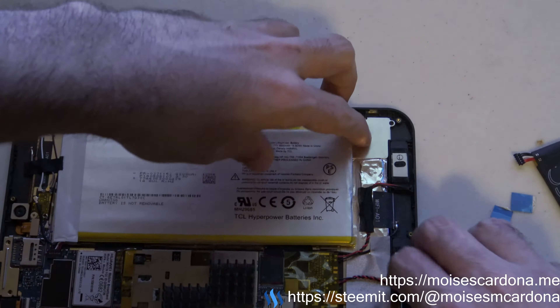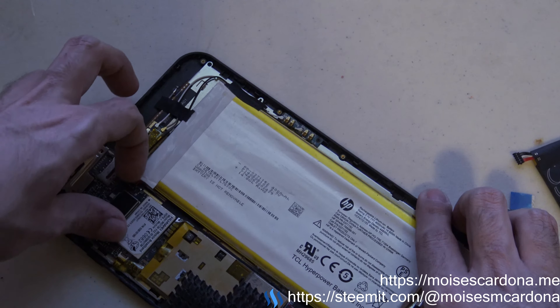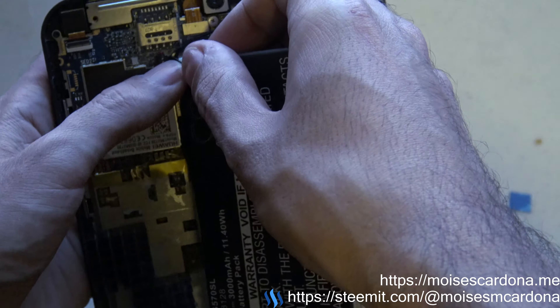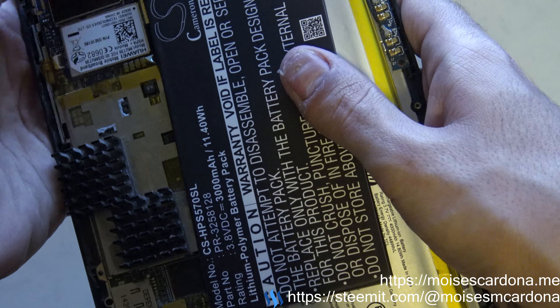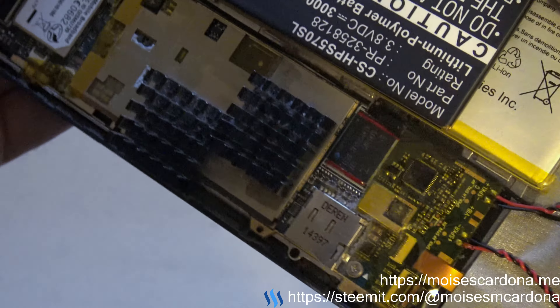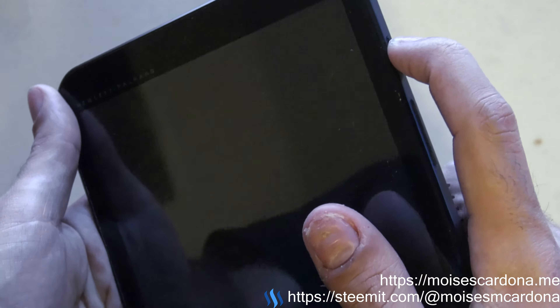Be very careful indeed, because the battery can be bad. Let's do this pretty quick — just detach the cable from here, and now attach the battery cable here. Because the cable is small. It should power on, let's see. This tablet is giving me some problems with the power button — I know this one is having some problems with it. There it is. 'Boot device not found.' In this case, because I tried to install the operating system and it shut off because of the bad battery, there's no operating system installed for this one.